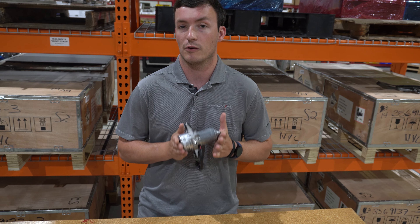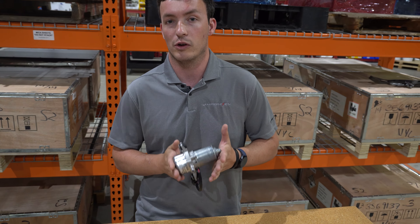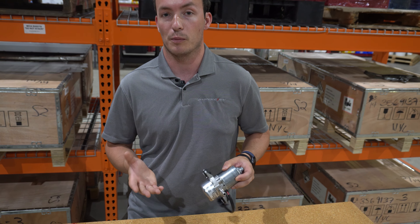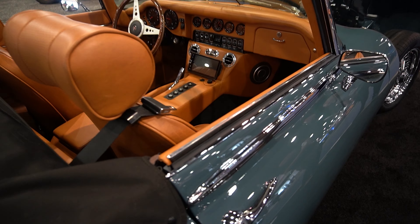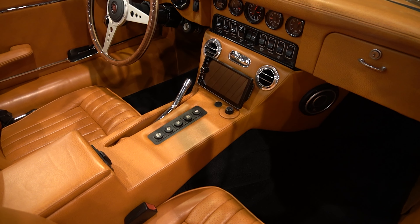So for a vacuum pump, you could use these for a lot of different things inside your vehicle — it's going to be a bit dependent on what you're doing. In many vehicles, your brake systems are powered by the vacuum from your engine. This pump lets you keep that feature by providing that source of vacuum.